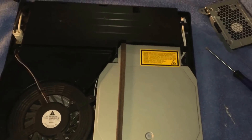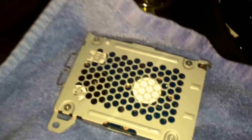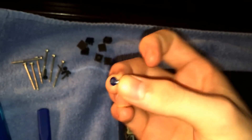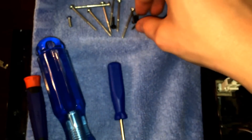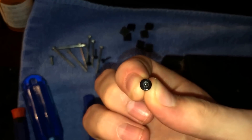First thing I'm going to do is take the back screws off and the underneath screws and get the hard drive out from your PS3. There's going to be a hard drive screw which is blue, there's going to be 7 of these, and then 4 T8 Torx security screws.